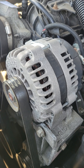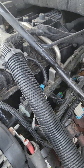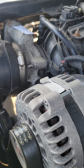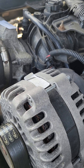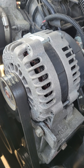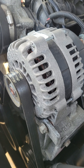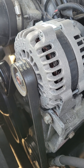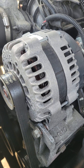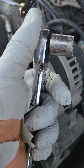It's pretty much the same on every car. Some alternators are in a tighter spot and others are easily accessible. On this Denali at the junkyard, you would probably have some sort of cover there — all you have to do is look for any type of retaining clips, screws, or sometimes they just pop off. Before you start working on a task like replacing the alternator, you always want to disconnect the black cable from your battery. This will keep you from potentially shorting out any fuses or doing harmful damage to your vehicle's computer.